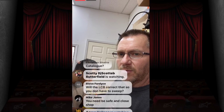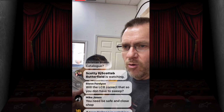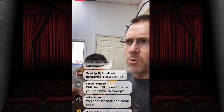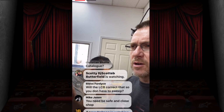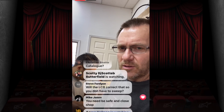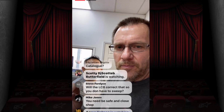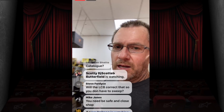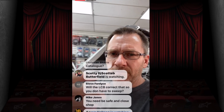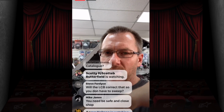And why this is important is that an LC product or a WaveTech or any high-level to low-level adapter, we'll keep it WaveTech or Audio Control, because those in my mind are probably two of the higher-end units out there. I know there are some others, and I apologize for not mentioning them. When you feed something into it, it will mirror that all the way through. Once the signal comes in, it matches it, it just lowers the output voltage, it doesn't color it, and it comes out the other side.